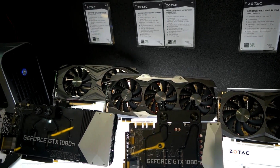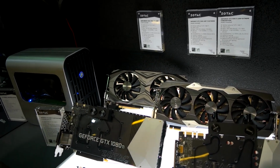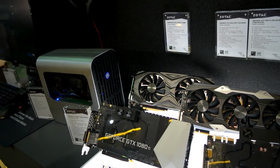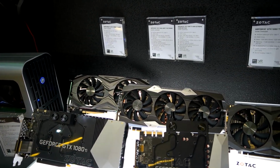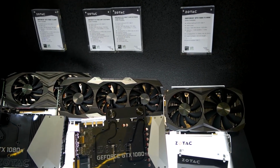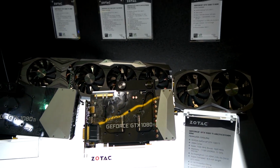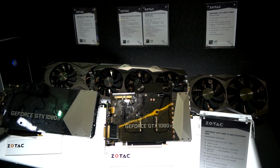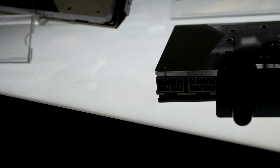It has 5 6mm copper heat pipes and has an all-metal backplate where it's color neutral, so it's going to match or fit or go into pretty much any existing systems out there with any type of color schemes. So that's something that's also very important for us. It's only going to be LED lit white because the board itself is too small to support our RGB module. So it simply doesn't have support for the fan stop or the RGB lighting.